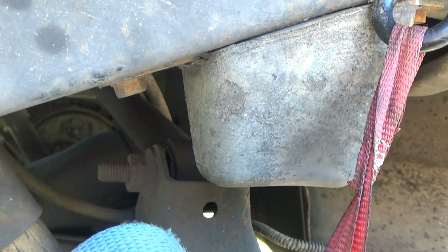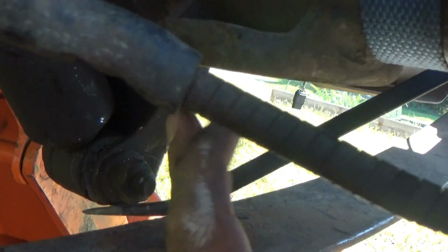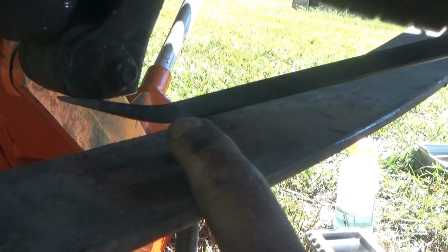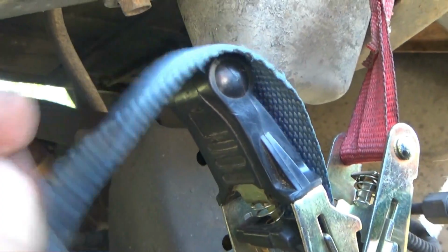Okay, because of the track bar being right there on this side differential, it's not as easy to get that centering bolt in this place right here, because you got to be able to bring the location bolt in here at an angle to get it coming through because of the pad here. There's not enough distance. So taking a breaker bar, pushing down on the leaf to separate this, then you can feed the bolt down. We tried to jack the rear differential up, but because of the track bar being here, it's actually picking up the whole Jeep, leaf and all, obviously. So if you can't move the rear end up, move the leaf down, pry down with the pry bar, drop the bolt through.